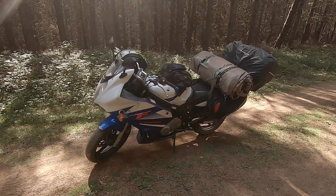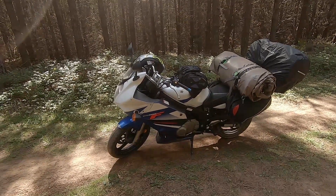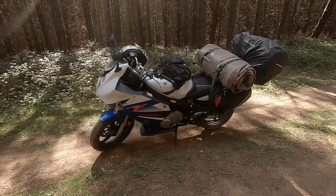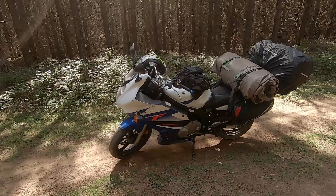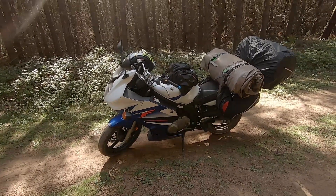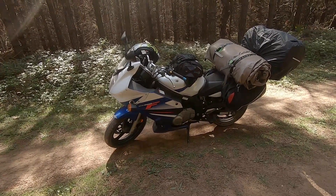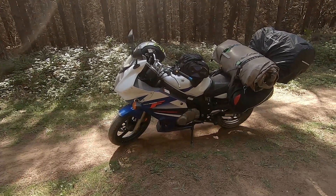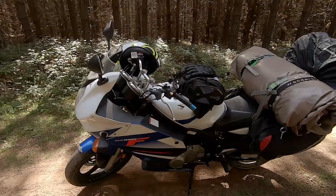One thing I'll say if this is a beginner bike: I have not found any oggy knobs for this bike — also called crash knobs — which are the rubber knobs you put on the side of a sports bike to stop it from being damaged when it falls over. Once you take the fairing off, there isn't really anywhere to attach one of those knobs. The supports under the fairing hold the fairing on but none of them are strong enough to take the weight of the bike, so if you do drop it, odds are you will damage the fairing. I have dropped it quite a few times, mainly from a standstill.